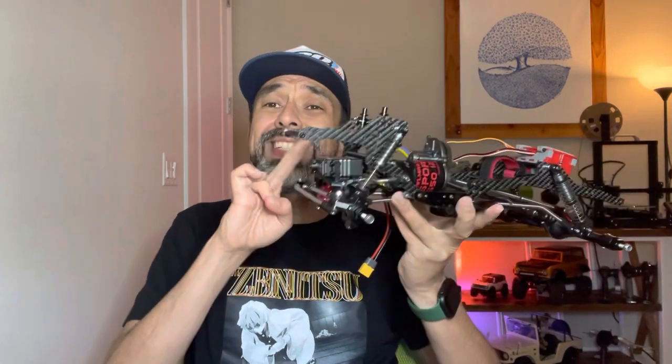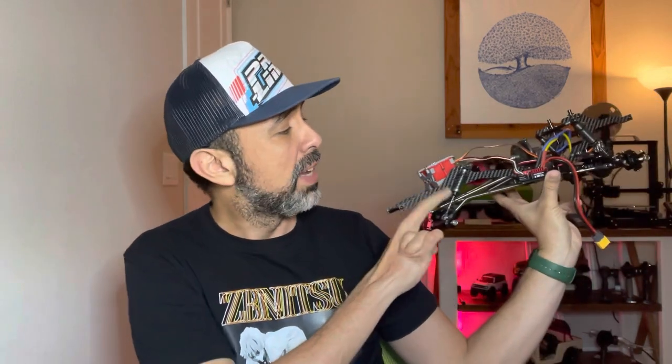This chapter wasn't related to the chassis, yet I have to say some stuff. Now that I put everything together, the chassis is not that straightforward. I had to put a lot of thought into some things. For example, when I installed the axles, my shocks were rubbing the actual chassis, so I had to play with the length of the links. You will have to do a lot of tuning in order to get a setting that will work with this.